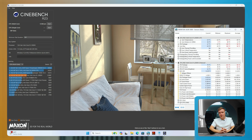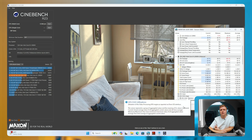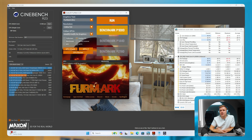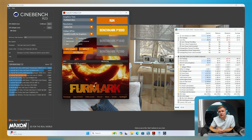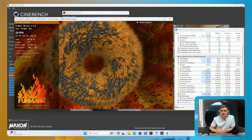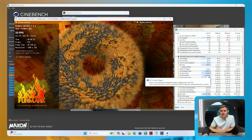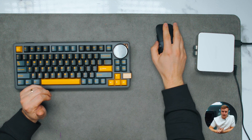Check this now — 12,000 points. We literally gained 20% extra performance. It did thermal throttle this time though, hitting 101 degrees. It's still going quite warm but there is a bit more performance in store there. Looking at graphics power in Furmark, we're still not pulling the full 80 watts PL2 — only pushing less than that, so not particularly great for frame rates. 23 frames, GPU pulling about 20 watts. I wouldn't say this is for gaming, but let's take a look at what's inside — we've got another crazy idea.